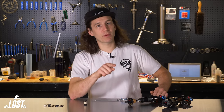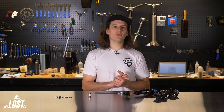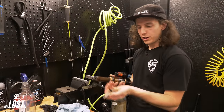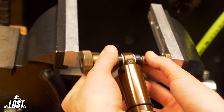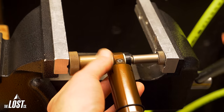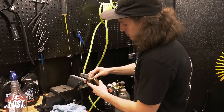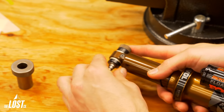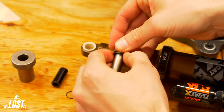Let's uninstall some hardware — whenever working around suspension, the goal is to not scratch anything. First, remove the outer spacers and inner pin. Try removing by hand first, which works on most RockShox hardware. If it won't come off by hand, use the vise. Take your mounting hardware removal tool, pop it in the shock hardware, line it up in the vise, and tighten the vise — it pushes one side into the other, catching all the hardware on one side. Now your hardware is removed, leaving just the bushing.